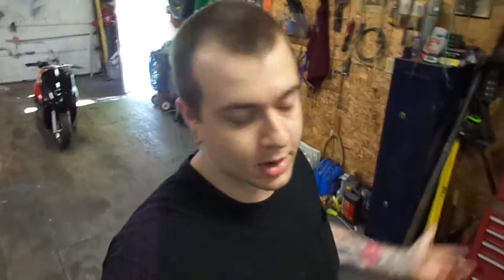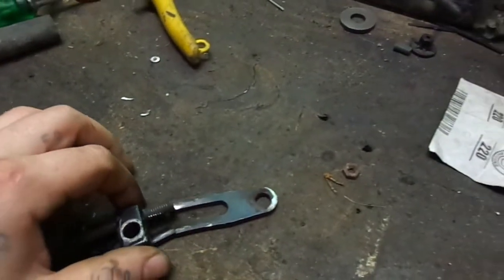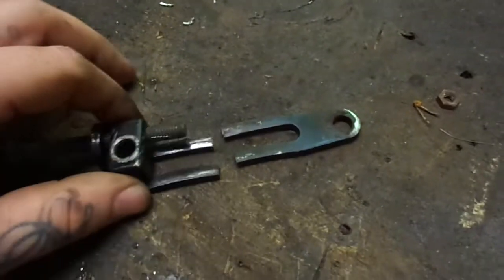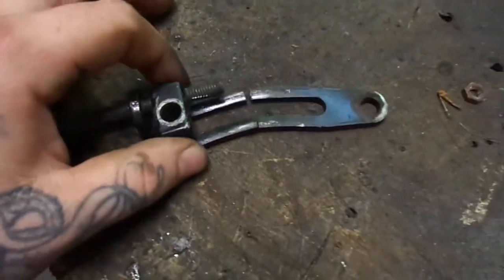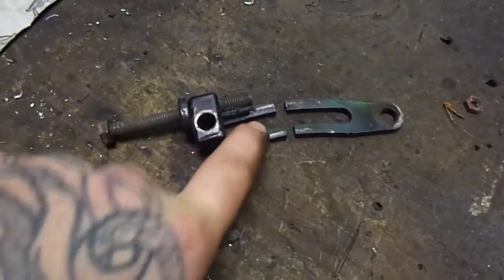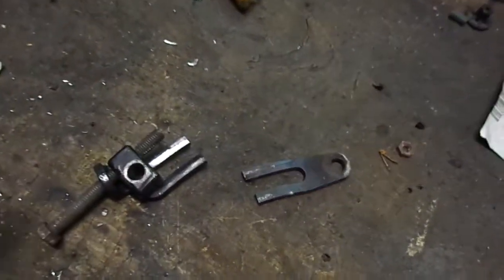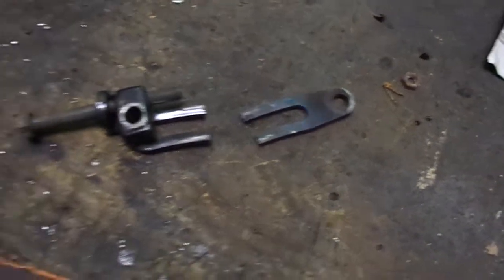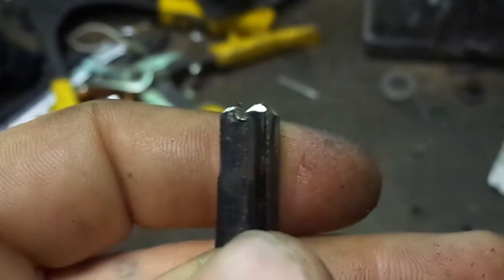See you in that last clip, my alternator bracket took a shitter on me, and you couldn't really see exactly — you can kinda see the crack, but you couldn't really see how it was broken in the video. So now it's off, I'm just going to fix it and show you what happened. Basically, the bracket is supposed to sit like that, and she broke right there in the middle. The alternator was attached to this half; this is the half that was on the block, so the alternator was just free-flowing. So I'm just going to grind that down and weld it back together and we should be good. These edges are beveled, as you can see, and it's finely focused, so hopefully everything works out good.